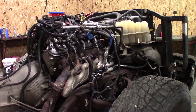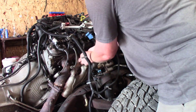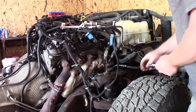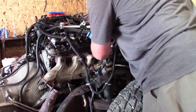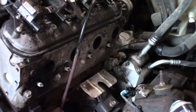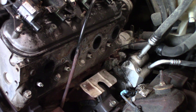Let's go through both methods and I'll show you how it works on this torn-down truck. First step: remove the exhaust manifold. On the passenger side of this truck, it's business as usual — rear exhaust manifold bolt broken, front exhaust manifold bolt broken. All the other ones came out okay, but I'm still going to run a tap through them just to make sure that whenever I put everything back together it goes together correctly.